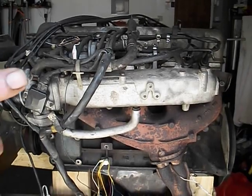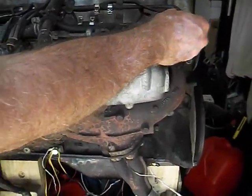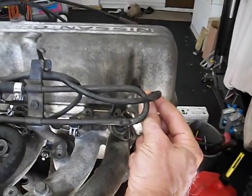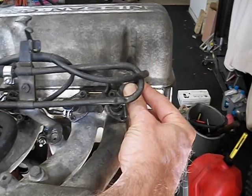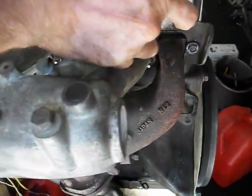The first thing I'm going to do is disable that cylinder. Listen to the change in RPM — virtually no effect. Off, on. Now we'll do a control with the cylinder next to it. Off.